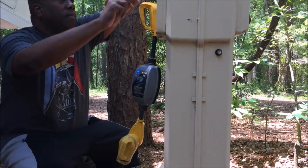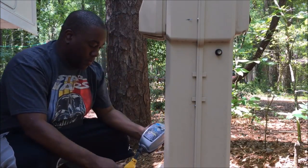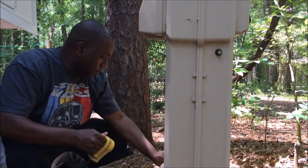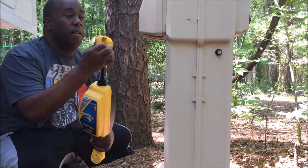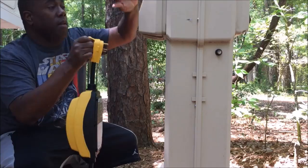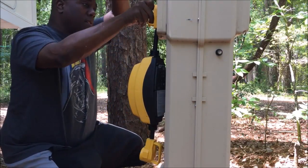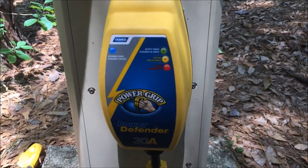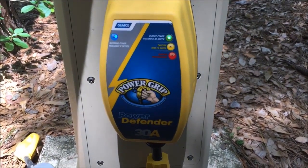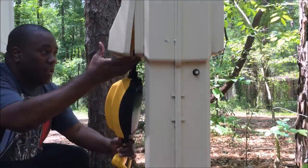As I mentioned, I always have a surge protector on my rig. I'm taking it off here and unplugging it, and then I'm going to put in the new one. Make sure you always put the plug in first and then turn on the power to your surge protector before you hook it up to your RV. By having your surge protector on, you can tell what the power is like at the campsite, and that will really protect your RV before you plug it in.